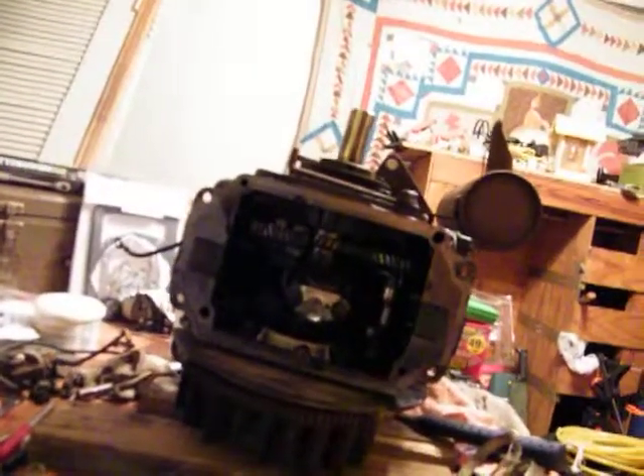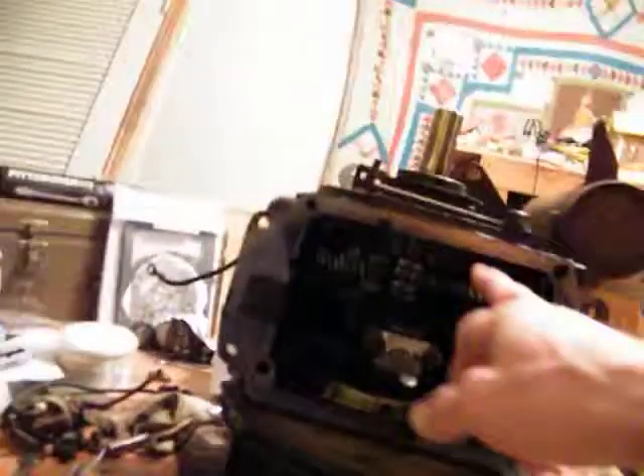There it is. I'll torque it down. What I did was — I don't have one that goes to inch-pounds, and it's 260 inch-pounds on these, on the rod. So I looked it up and converted it from inch-pounds to foot-pounds, and it's right at around twenty-one point six six six foot-pounds.